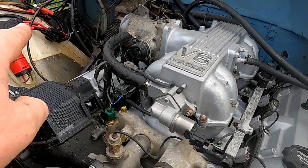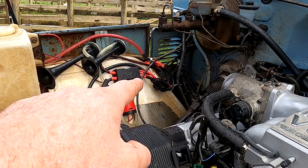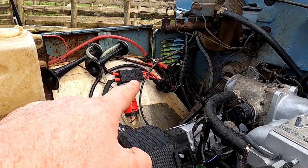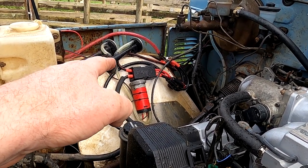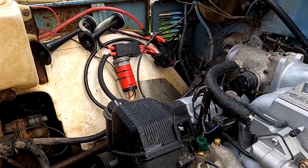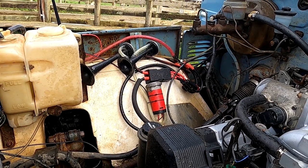You've got a fuse over there. So you've got the big ones in the waterproof things down the bottom there. One of them's the AM1, like all the ignition feed into the cabin. And the other one's a little one. And then you've got your alternator fuse and your injection fuses actually in that box. So that runs in on that braided cable there, inside and across. So everything's fused like it should be.